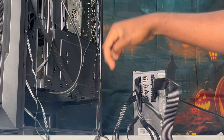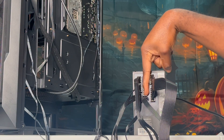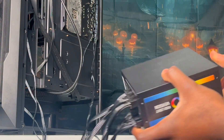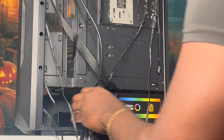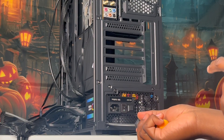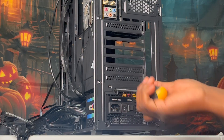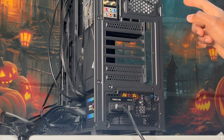So we've got the CPU plug, the GPU plugs, the motherboard plugs, and we have a SATA cable plug. Now we're going to plug them all into the case and slide the power supply into that slot. You always want to make sure you put your power supply fan side down. Now we're just going to put four screws in there. It pays to put this in last because some of the cables were just above it and you don't want to have to take it back out to push cables through.